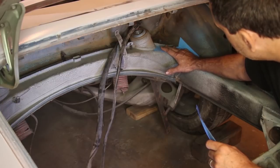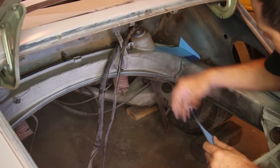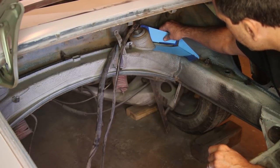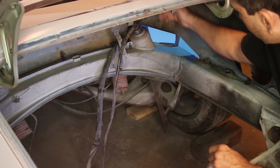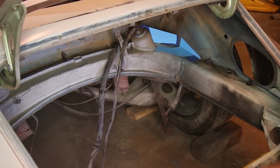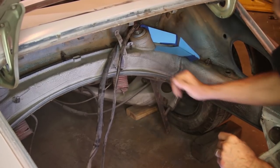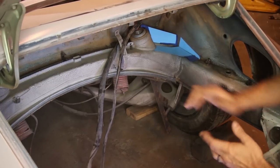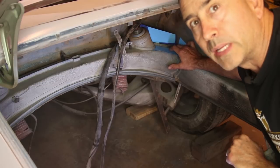First, I'm going to put this piece down, and it's going to roll up along the edge and get welded around, and then this piece will come on top, and I can weld it from the front, and then it's going to fold over and come down, then I'll weld it again. So it's going to be a hollow structure here on the top, and this is going to be bolstered all the way back behind here too. So these aren't the final templates, I'm just working it out. There's more to it than just this.